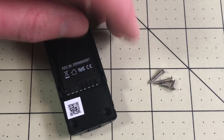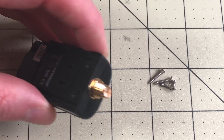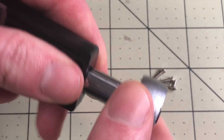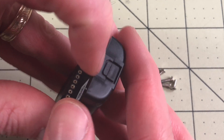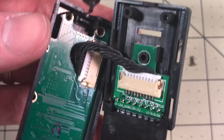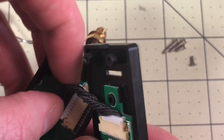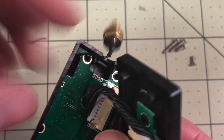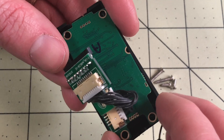So here's my module and I've taken the four screws out — there's just four screws in the back. You do also need to at least loosen this nut. This nut is the same size that you may use for removing prop nuts. So this is what I use most of the time and that'll loosen that up — it was just a little more than I could get finger tight. And then here on the bottom, this should pull apart now very easily. When you're taking it apart, if you can avoid it, don't take this piece out — just unplug it.